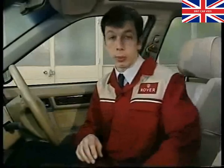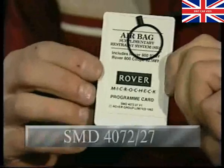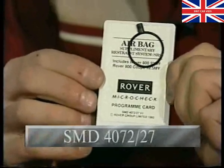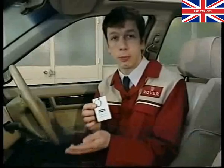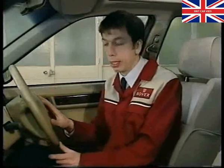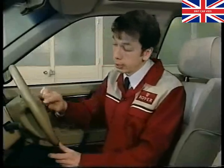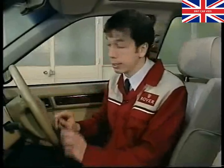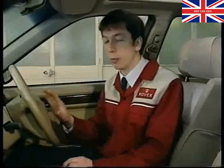Another thing you'll need when working on the airbag system is a microcheck card and its accompanying harness. The diagnostic port you'll need to connect your microcheck into can be found just to the left of the DCU. Although the airbag module has a lifespan of 10 years, it should be visually inspected on an annual basis to make sure there aren't any cracks or the unit isn't distorted. If it is, then you'll need to replace it.